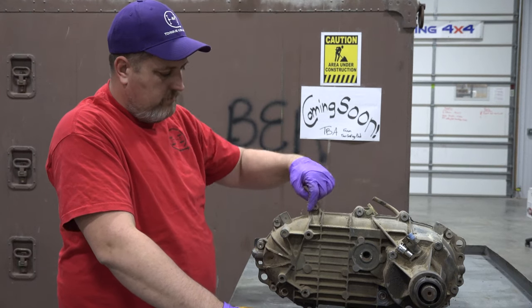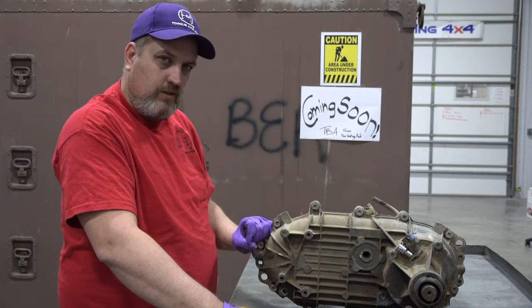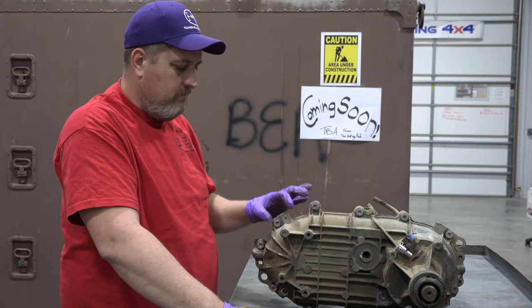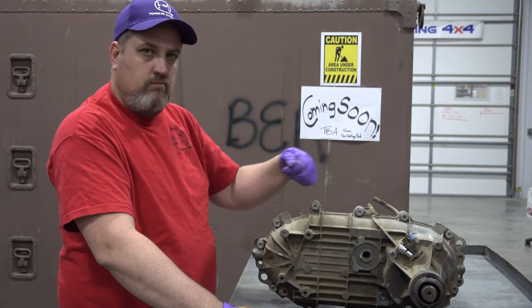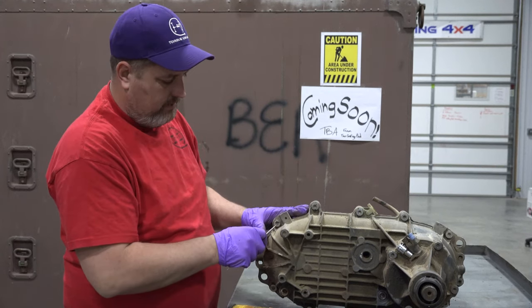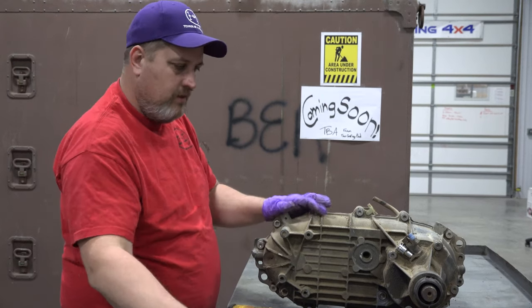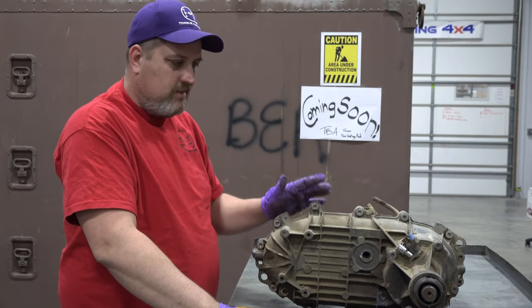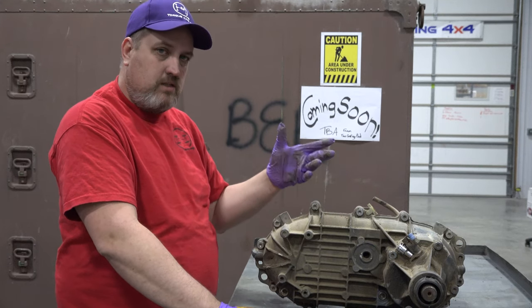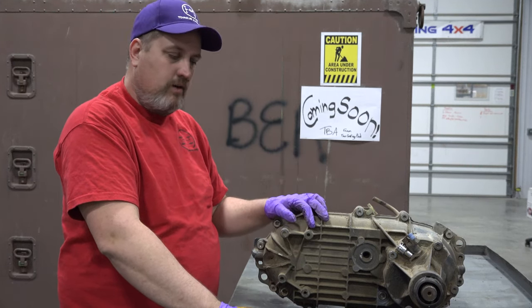I've gone over all of my bolts that I've got here on this 1356. They're all a T47 Torx head bolt. And I went through them all with a pick, just like that there. Cleaned all the dirt out of them and did some more of that stuff because that's kind of boring to watch. But it's important to know that you want to get everything as clean as you can, especially if you're trying to put that transfer case back together right away.